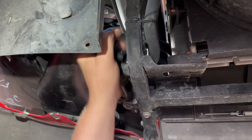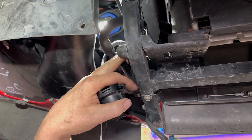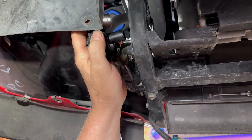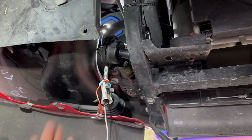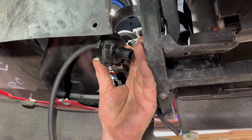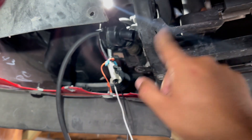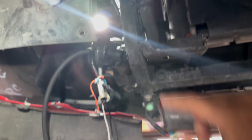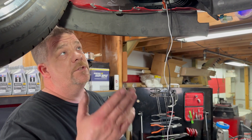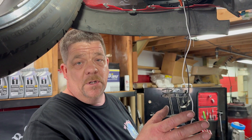You can see that pump is turning on. Now that might sound healthy to you but it's actually a little bit weak, especially when he demonstrates here. We're going to test this diaphragm — it pumps up, opens up, and allows the air to go through, but when it comes through it's not very strong, and it's also got to open those two valves up there. Now that we've checked the air pump, we know we've got low flow. We checked the diaphragm and made sure it opened up and operated the way it's supposed to. We know we have an issue with the air pump — it's not blowing enough force to go through the valves.